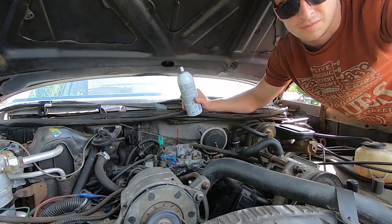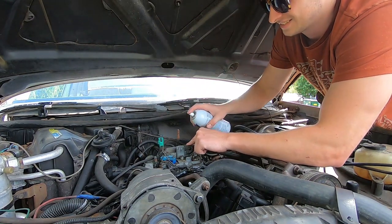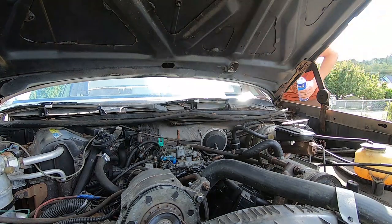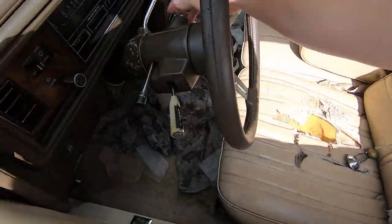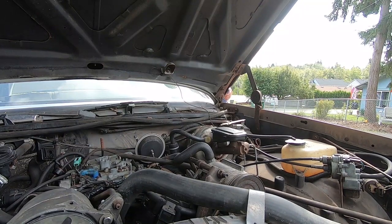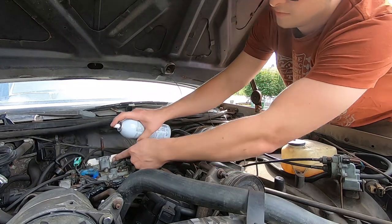If I ever said I was good at this, I apologize, because I'm not. I processed that I didn't prime the fuel pump after trying to crank it for about 20 minutes. We're gonna give her a shot. Try and spray it and start it and then maintain it running for just a minute so it'll actually pull fuel. So yeah, okay, here we go. Dang it. This is gonna take a few tries. That sounds like battery. See if we get another shot.